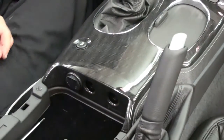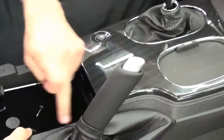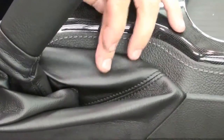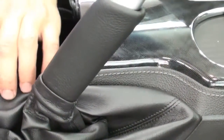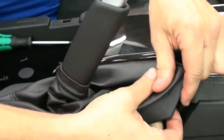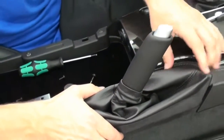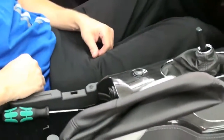The emergency brake base of the boot is held in with two clips. If you know approximately where they are — about halfway in between the front of the e-brake and the front of the console, and right at the base — you want to pull up and support right there and just kind of pull up and it'll pop out. Come over to the other side and pull up, reach up in there. You don't want to yank on one edge or the other because you can tear the boot, crack the plastic, or bend the little clip. Just pull it all the way up over the boot and drape it over top like that.